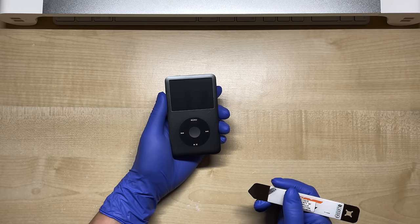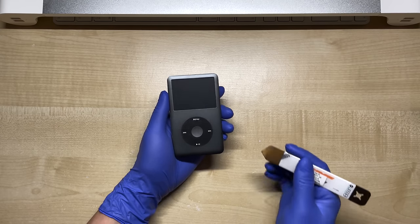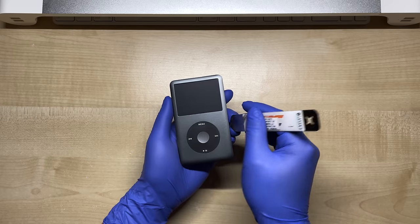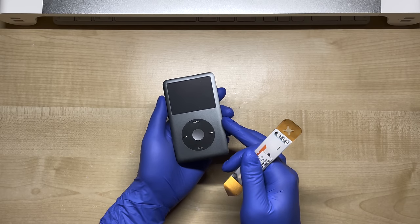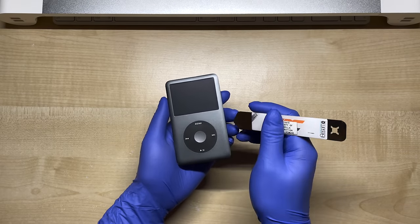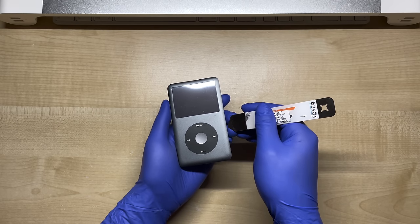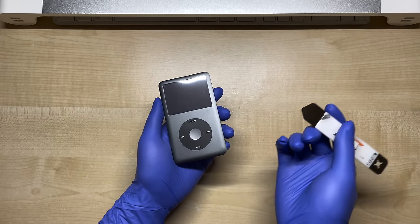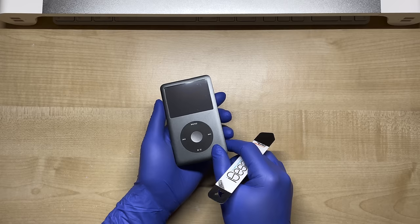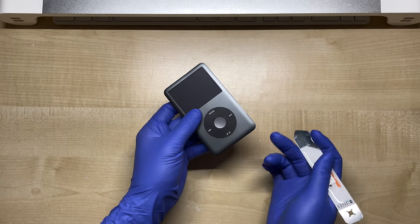A lot of people say that these iPods are the hardest to open, and while that's true, there is a trick to it. Normally when people open older iPods, you'd insert the pry tool and then pry upwards to release a clip, but on these newer ones you can't do that because it'll break the rails on the inside. So instead, we actually need to pry inwards to fold down a clip, and then pry upwards to free the front panel. It also helps to have more than one of these pry tools, but this one's been opened before, so it should be much easier than a brand new iPod. We just need to lift up one side and then the rest of it should give way.